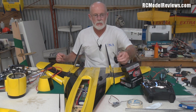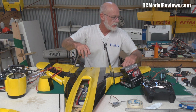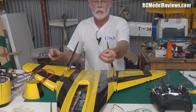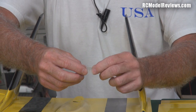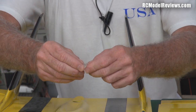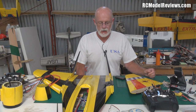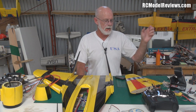The whole kit came quite nicely — it has some nice features, including sprung main gear oleos. They're not super high quality but more than adequate. What surprised and shocked me the most was the hardware for the control surfaces. Here's what I'm talking about — this is the control horn for the elevons. This thing is probably flying well over 160 km/h on a full pack, and this horn is ridiculously small, tiny, and flexible — it'd break off in no time. The slightest hint of flutter and there goes your horn. I'm not going to use that cheap hardware; those horns are useless and your model will crash.